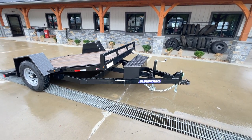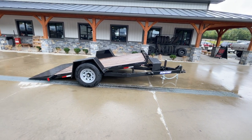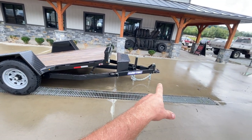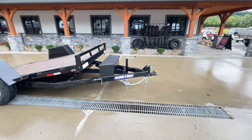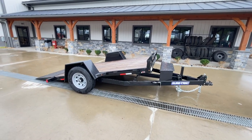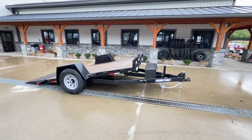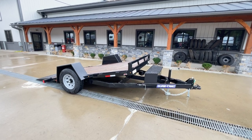On a tilt trailer, your axles are generally going to be slid a little bit farther forward to get that lower load angle. Two ways to get the angle: one is the drop axle, and two is that the axle is pushed to nearly the center point of the trailer. To balance out weight to the tongue side, this trailer is going to have a longer tongue than most trailers this size — probably in the neighborhood of five and a half feet, versus a typical tongue of a touch less than four feet. So your axles on a tilt trailer are generally slid up about a foot to a foot and a half, and to compensate, your tongue on these is a little bit longer. So a 12-foot trailer that's 12.9 on the deck, with about a five and a half foot tongue, is going to end up somewhere in the 18.5 feet range tip to tail.